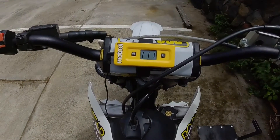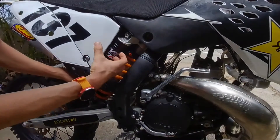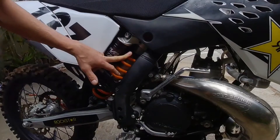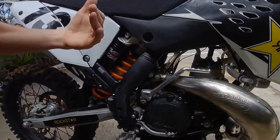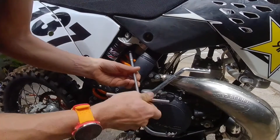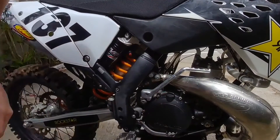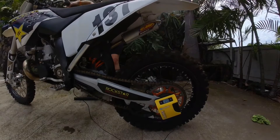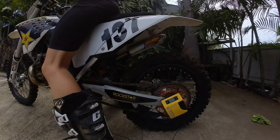My sag is way too soft right now. Normally you'd loosen some collars — on a lot of KTMs you loosen a hex bolt and turn the shock spring and collar at the same time to increase preload. In my case I have a quick adjuster installed, so I can make fine tuning at the track. Last weekend the bike was riding real far back and flying front-end high off jumps. I'm going to put an 8mm wrench on here and increase the preload on my shock. I'll make a bunch of turns and remeasure.